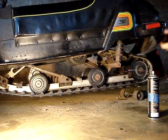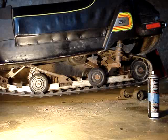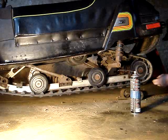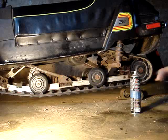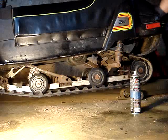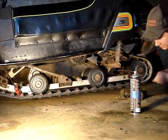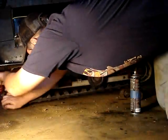So you're going to take your track skid, put it the right way, and you're going to line it up in the back and you're going to shove it on. Also a good idea, spray a little Tri-Flow on the end of this. Helps it go easier. Right there, it caught the track. Now, just going to take a screwdriver, push it here, get it wedged in there, go back, shove it up till it hits it, move the screwdriver up farther.